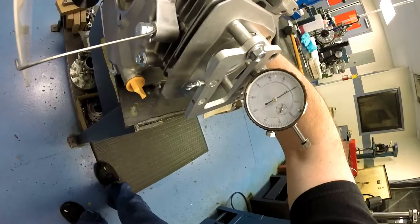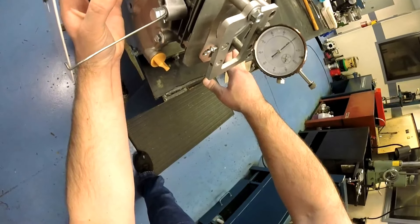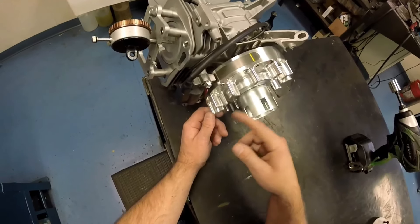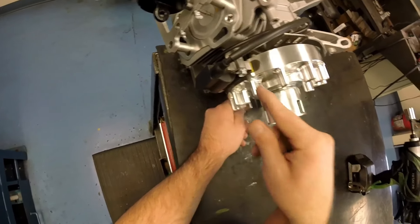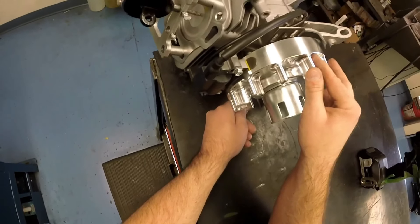Put the cup on, take the nut and — you don't want to really tighten it — just want it to touch, then back it off a little bit so that you can still turn the flywheel without turning the engine. Make sure everything's still zeroed out. As I showed you in the last segment, what you're looking for is the leading edge of the magnet lined up with the right-hand edge of the coil. The leading edge is the first gray line as the engine rotates. I've got this one painted yellow so you can see it, but normally they're gray. It doesn't have to be precise — just as long as it's on the edge, kind of in the middle of it — as long as you're in the vicinity of that line, you're good.